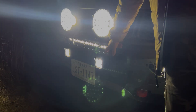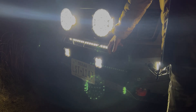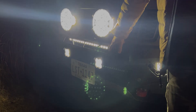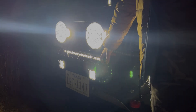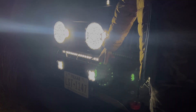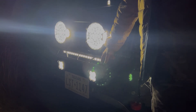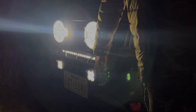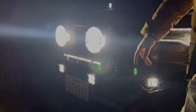I didn't have any other lights when we first got this, so this one's just a flood — I just wanted a little bit more area lighting. But you can fit a 20-inch light bar in there. Be sure you read your specs because some of them are actually 20 inches wide overall and some of them just the light bar portion is 20 inches, so you can actually fit a slightly bigger light bar depending on the brand.